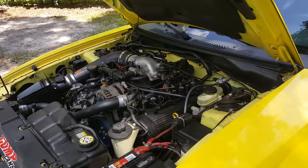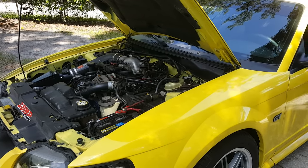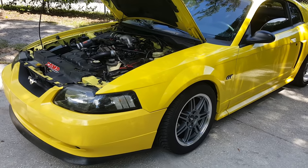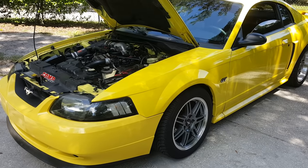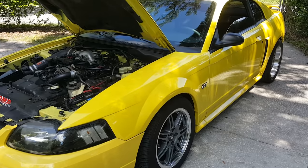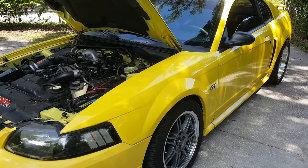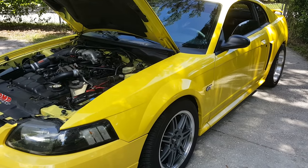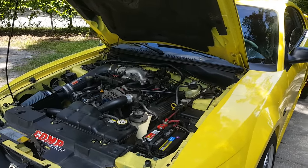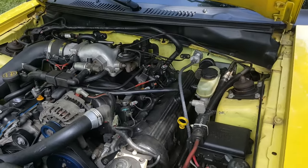After all that, I would definitely check your fuel pressure under full throttle. If you have a live data scanner, make sure you have a consistent 40 psi fuel pressure under full throttle — that is so important. I'm on my second fuel pump. The first one was dipping down to 29 pounds under full throttle. After I put in cams I noticed detonation at high RPMs and I was dropping to 32 psi. New fuel pump in now, everything's good.